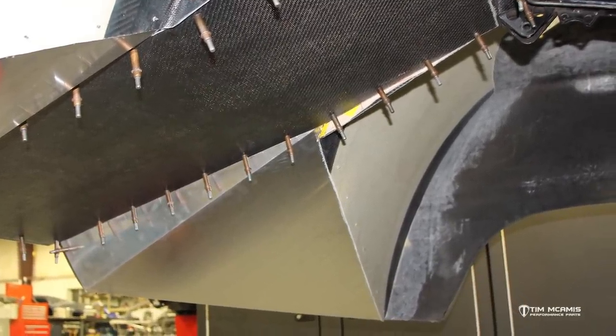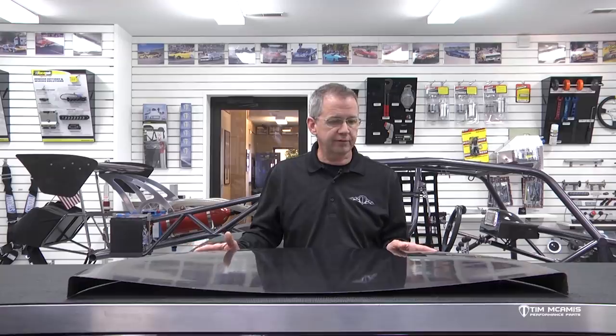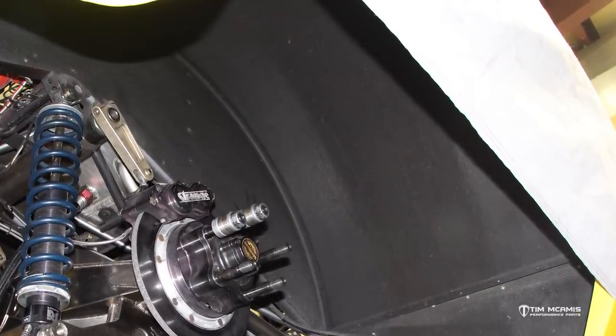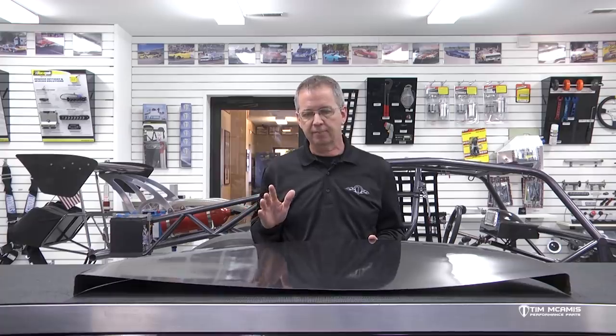We have four sizes available, all in carbon, and we build in a little core liner underneath the center of the tub. That core strip helps stiffen the tub and also protects it from rocks picked up on the track slinging up into the carbon and putting a little star chip in the exterior surface. One thing different from old-style aluminum tubs is rubber removal — you can't just scrape these with a putty knife. You can use something like a dull-faced putty knife and lightly scrape along there to get excess rubber off, but be careful not to dig into the carbon surface. Hope that helps — check our website or call one of our sales guys if you need more help. Thanks for watching.